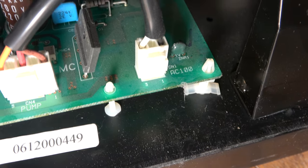Okay, I've got a little under 20 volts for my power supply. It's current limited to just a few hundred milliamps. Let's connect that up. There's a little spark then from the capacitor charging up. So we have capacitors at 18 volts, and this is ground here on the right. So this regulator here, 15 volts output. 18 in, 15 out. And then our 5 volt regulator: 15 in, 5 volts out. Well, that's looking good.